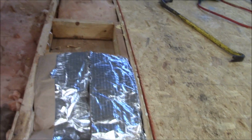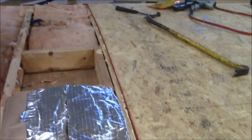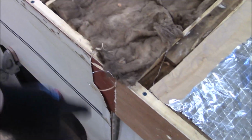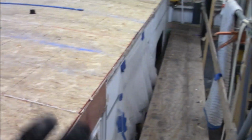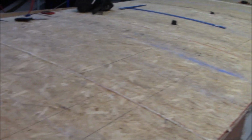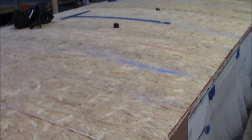But now, like I said, we got a couple more to go, and then you can see all the adhesive up in here. So we're plugging along. We got everything else fixed on the side here. We got this piece in. This piece, I explained that already, so we'll epoxy all that back together. At least we were able to move the scaffold over so we could work a little more comfortably. So the next step is clean it all up, get the staples down, put our protective strips on, and then start getting the roofing on here, right?